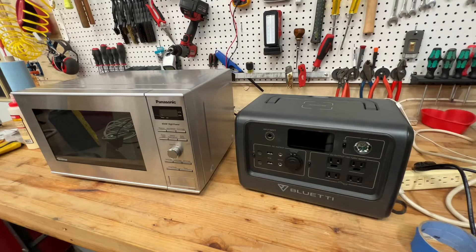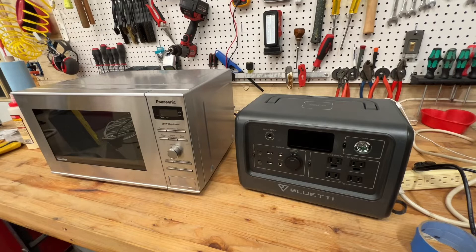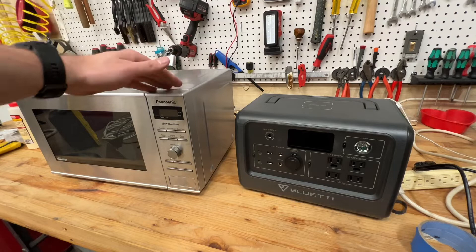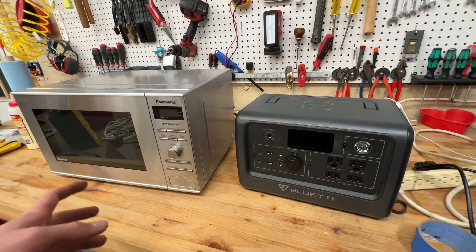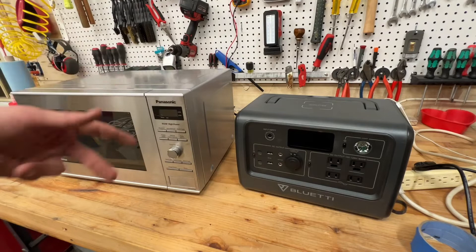When you're trying to run a microwave, you need to get one of these inverter microwaves. This is Panasonic's patented technology. A standard microwave just switches the power on and off — so if you dialed it down on a 950-watt standard microwave, it would run at full 950 watts for 3 seconds, then be off for 6 seconds, cycling like that. An inverter microwave actually dials down the watts being output, which is why you need this type of microwave to use it with a battery that's undersized.